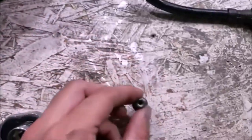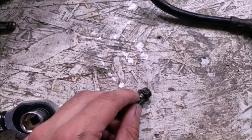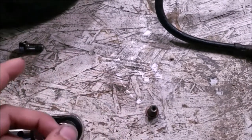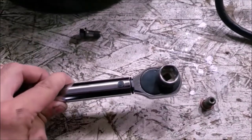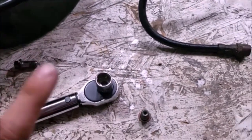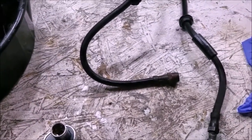These banjo bolts are hollow — there's a hole down the bolt and it comes out the side through the fitting, so don't over-tighten them. This kit is recommended for 12 to 14 foot-pounds. To convert to inch-pounds, multiply by 12, so I tightened it down to 144 inch-pounds. My torque wrench doesn't go that low so I had to use my quarter inch drive one which is in inch-pounds. Everything went on perfectly.